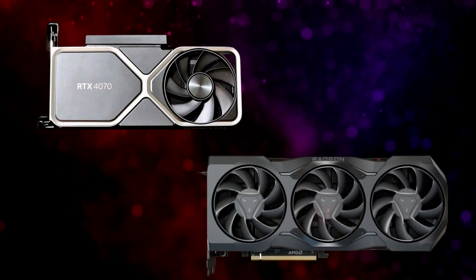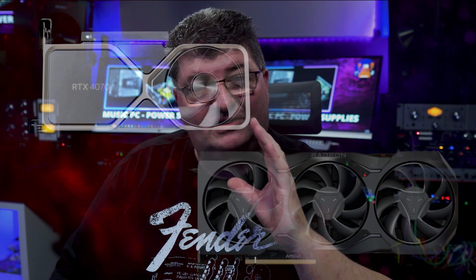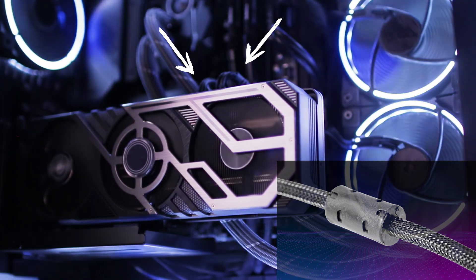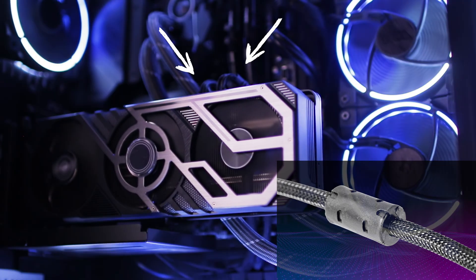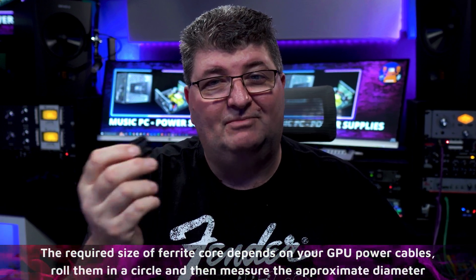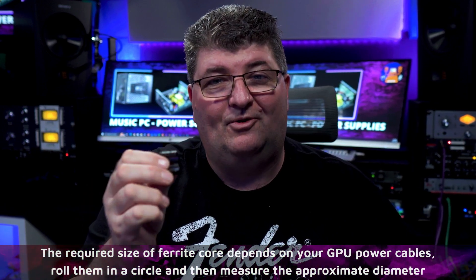Now for my bonus tip to reduce noise from one of the most troublesome components in your computer: the graphics card. If your computer has an external graphics card, it is one of the noisiest components in your system, and that noise can leak into your audio path. All the power is connected inside your computer through the power supply. The solution is very simple and inexpensive: ferrite chokes. I've added ferrite core chokes to the individual power cables running to my NVIDIA graphics card, and I noticed a significant difference in noise — a big drop. They're very inexpensive, easy to install, and one of the first things you might want to try even before upgrading your power supply.